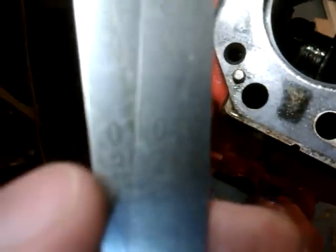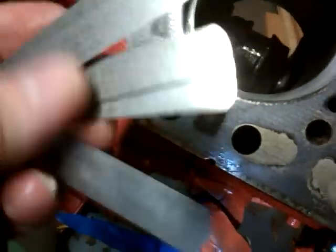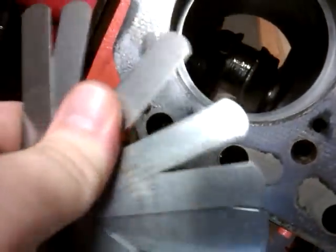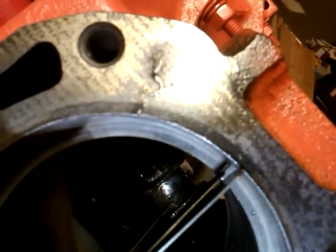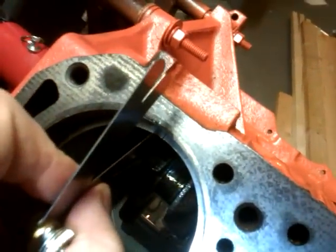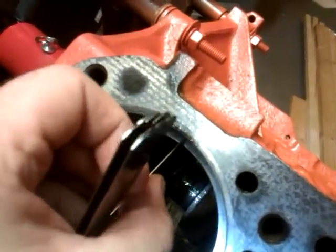You can put two blades together and add them — for example, a 0.010 and a 0.016 makes 0.026. You can do it either way. What I usually do is just fan them out and see which one fits into the ring gap. Right there — whichever one fits. We try 0.019 — 0.019 fits.